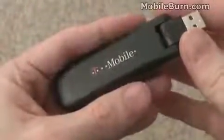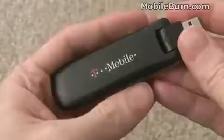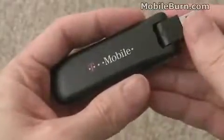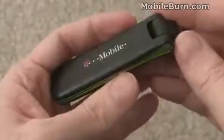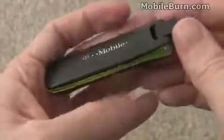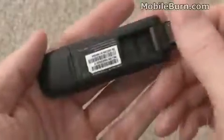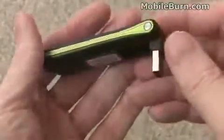In terms of connectivity options, the device will work on T-Mobile USA's AWS band network, which is split across 1700 MHz and 2100 MHz. It also works on the 2100 MHz 3G UMTS bands used in most of the world, and it can even roam onto 1900 MHz networks too, such as the one set up by AT&T here in the U.S., although I doubt it really can roam onto AT&T's network itself — it's kind of an issue with the SIM card — but in other countries that support 1900 MHz, it would work.